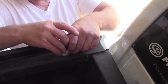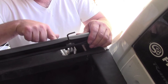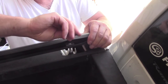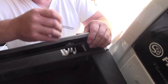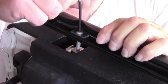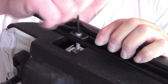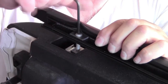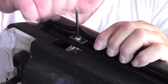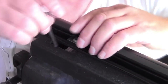You can see the way the front clamp goes into the stake pocket: the shallow U goes towards the back and the big U goes towards the front, hooking on the back side of the rail. We'll tighten this with the Allen wrench. At the back stake pocket, the big U on the clamp faces the front of the rail, hooking on the front of the rail. We take this down to basically finger-tight since we need to be able to move it to get everything adjusted.